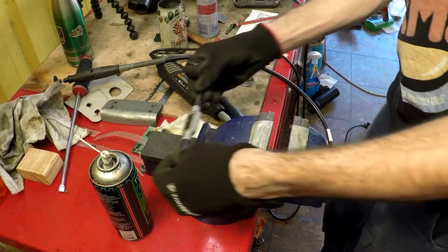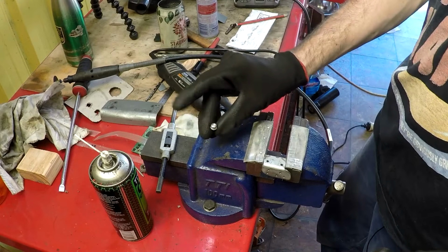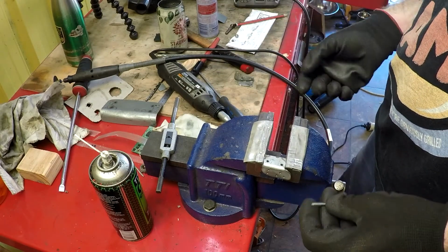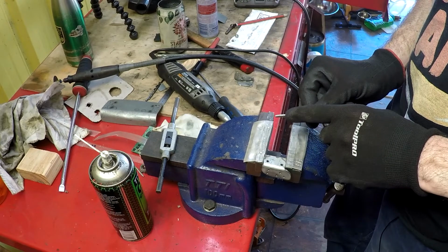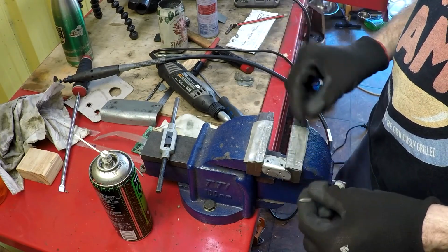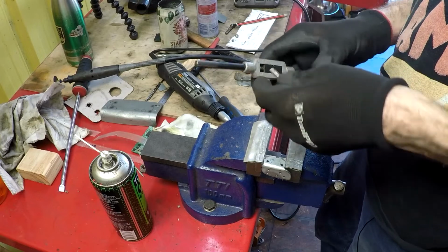You see, here's the fun part. I don't actually have the right tap for the screws that I want to use, which are these little ones. I don't have anything else that's really how I want, but I do have a tap. It's the right diameter. The thread pitches out by half a mil. But I did test tap another hole, and I think just because it's so short, it does wind in, so I think we can get away with it. Hopefully.